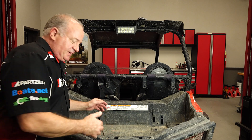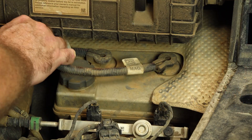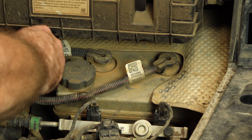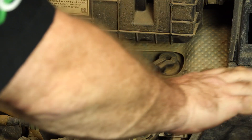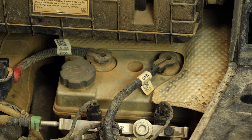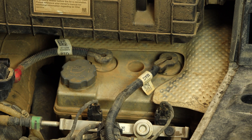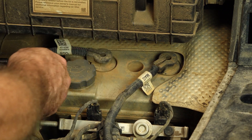Pretty simple to access this — let's just get this cover out of the way. With that cover out of the way, all we need to do is pull these two plug wires so we can access the spark plugs. That plug wire came off of there really easy. We can go ahead and determine which cylinder it is. I'm going to pull both plugs. So that tells us our dead cylinder is right there.